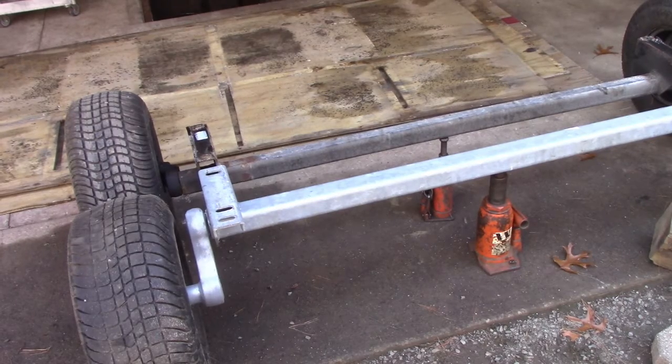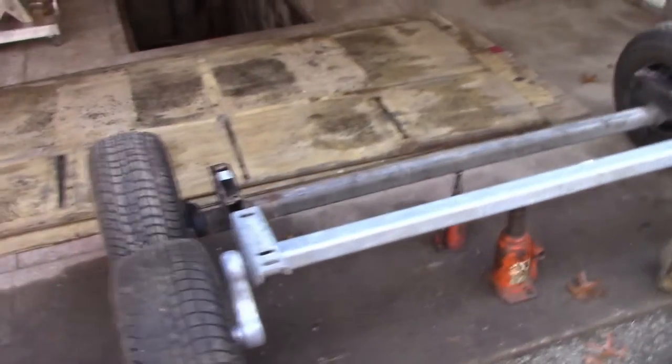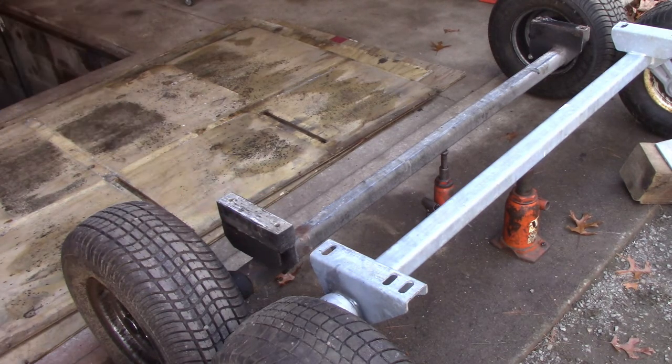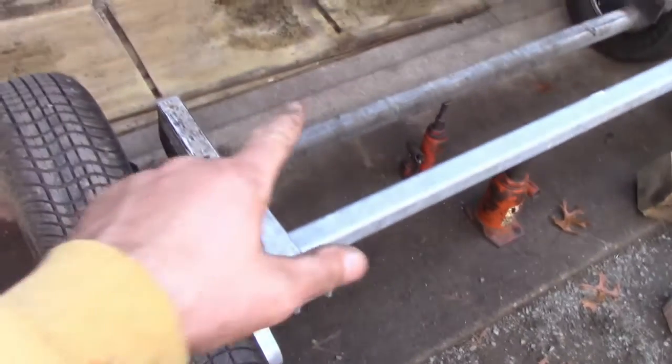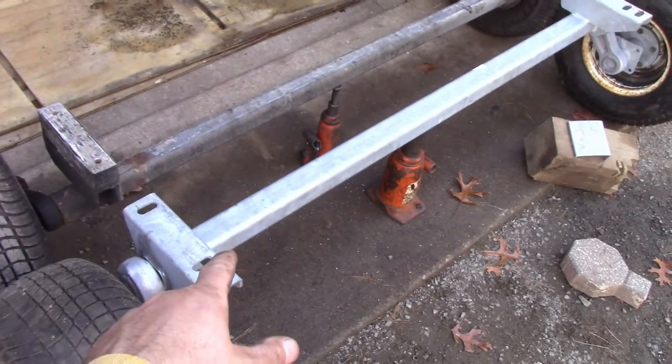So I got the old axle off and I got some spare tires on the new axle. It's perfect — actually better than perfect. The old axle and new are just opposing each other but the new one is lower. I ended up over the years adding a spacer out of aluminum and boosting it up on the frame itself, and it's almost the same level now with the new one. Clearly it's a thicker axle — it's a 2,200 pound axle as opposed to the 2,000 pound axle, and even the I-beam is thicker. I think that's two inches; this is like two and a half.